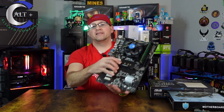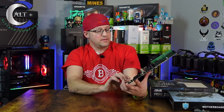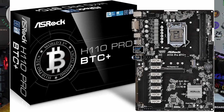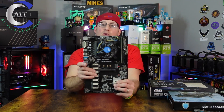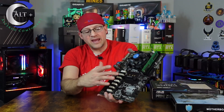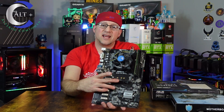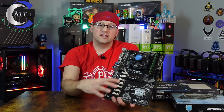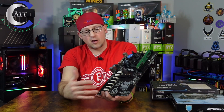The next board is its famous predecessor: the ASRock H110 Pro BTC Plus motherboard. This thing was one of the most popular during the last boom because it's again a 13 GPU motherboard, just like the Q270 Plus. It runs a single x16 slot for a full GPU plug-in, and it also has the 12 x1 PCIe slots.